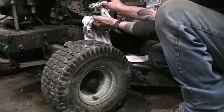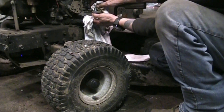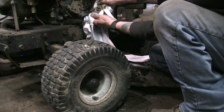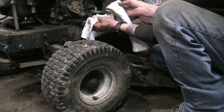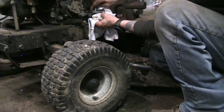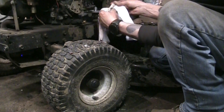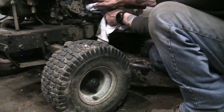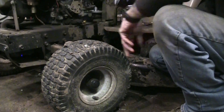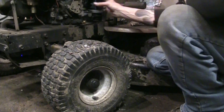That oil filter adapter is quite deep — it's got quite a bit in there. I'm going to suggest to the customer that he changes the oil again in another week or so, or even after the next cut. A lot of this gas will burn out, but for what it costs — a quart and a half of oil — leave the filter, put fresh oil in, and it'll get rid of a lot of the problems still lurking in that engine. Now it's all empty and dry in there. New oil filter has oil on the gasket — give it a spin — goes on a lot easier than it came off.